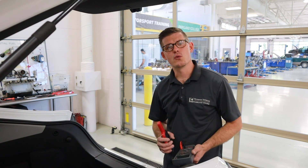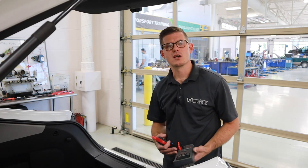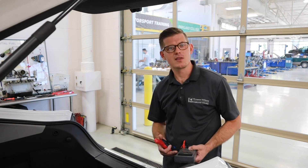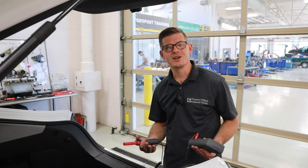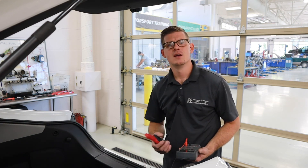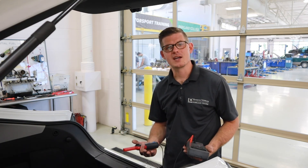The conventional method is to go through each fuse box, take fuses out one by one, and look for your drain to come down. Using a meter with a long lead or using something like a PicoScope where I can graph that parasitic drain can make that process a little bit easier. Another method is to check volt drop across the top of fuses. All of these are incredibly labor intensive and take some time. I do have to be careful — if I take a fuse out and put it back in and disrupt the power supply to a module, I'm probably going to wake up that module and cause capacitors to get charged again, and that's going to take a little bit of time for it to go back to sleep.